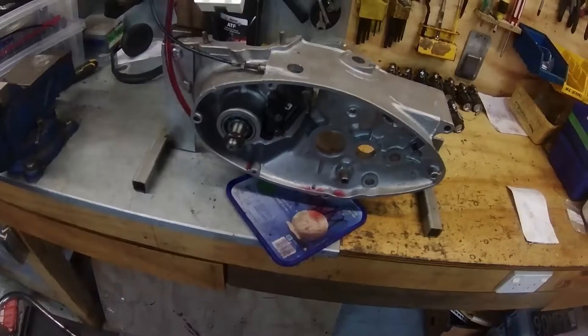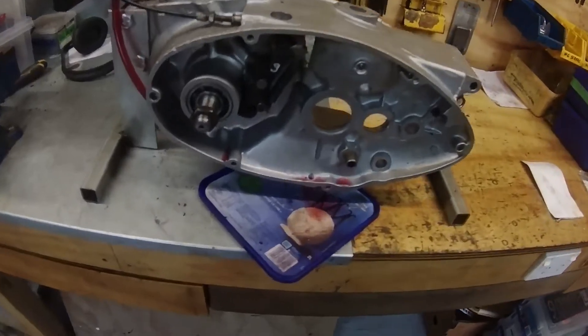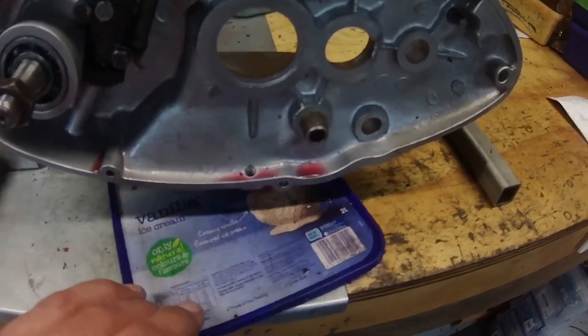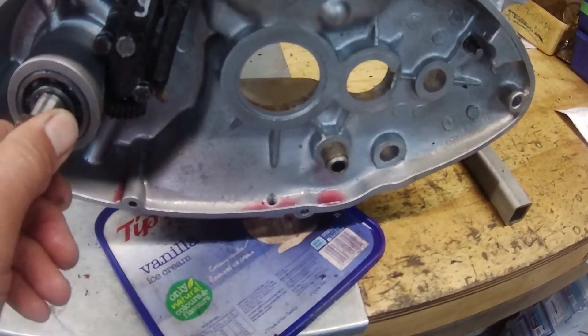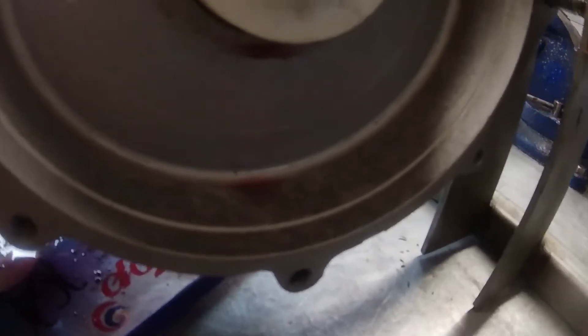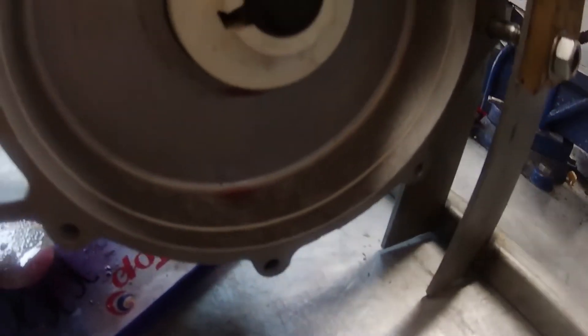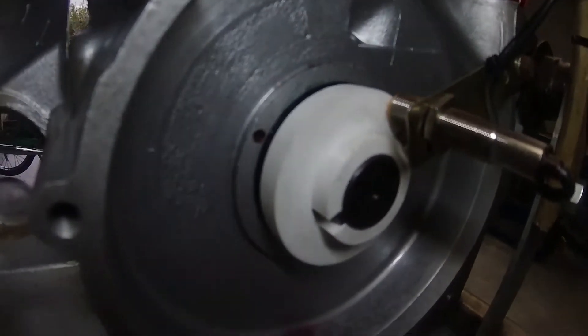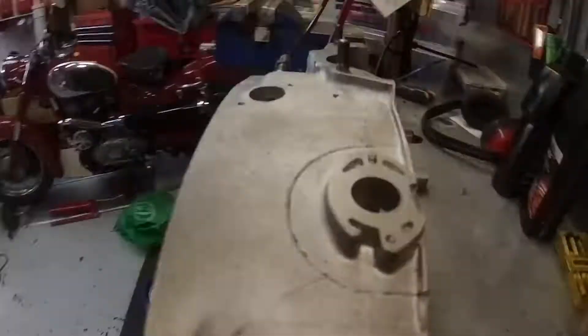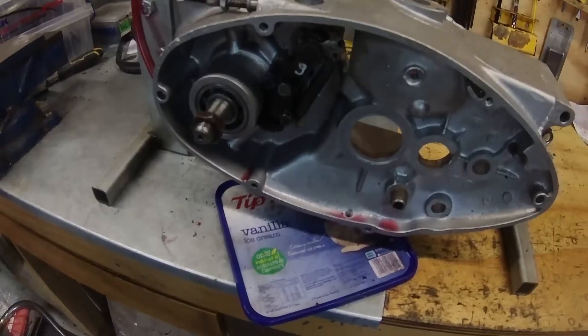Here is the crankcase after 5 days with ATF and as you can see there's quite a bit of oil coming out — quite a bit on the gearbox side, or the kickstarter side of things. There is a very small amount also in the crankcase. I'll turn the flashlight on — there's a tiny little bit of red as you can see. Also my new flywheel — I made a smaller flywheel so you can actually see the hole where the oil flows out, and you can see a little bit of red here as well. So over 5 days this has done exactly 2 milliliters.